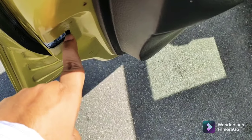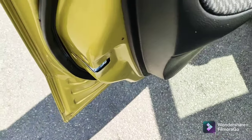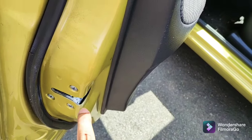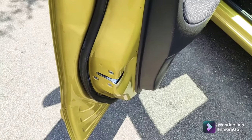What happens is there's a little pin there that just comes out — it comes loose — and you just need to put it back in. So the steps: I'm going to undo these three screws so that there's a little bit of movement, then I'm going to put a flathead down there and just try to push that pin back in, and that should resolve the issue.